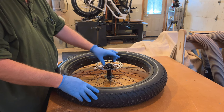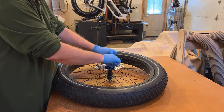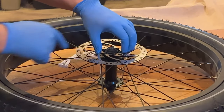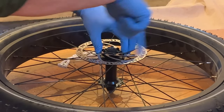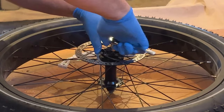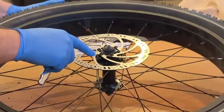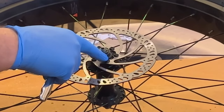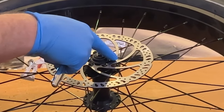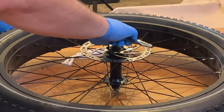Now I've snugged all these bolts down — you can see the rotor is still loose. I snugged them all down and backed them off a half a turn so there's a slight gap so you can move it. The wheel turns this way, so I'm going to rotate the rotor back against the holes, against the screws — rotate it back the opposite direction before I start tightening the bolts. That's to take up any slop and stop the rotor from having extra shear force as the brakes come on. Now to tighten these bolts, you're going to want to do it similar to the way you do a car — skip and hit every other one. It's a six-bolt pattern: skip, skip, go to the next one, skip, skip, then tighten them down. The first time around, just snug them down so they're tight.